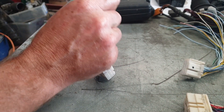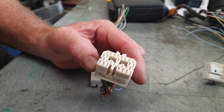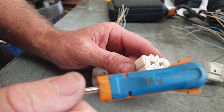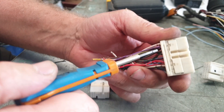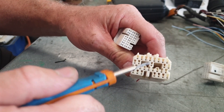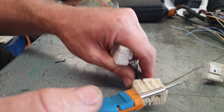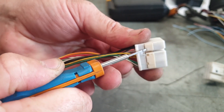Right, we're going to show you how to de-pin one of these plugs. Here's one of the tools I use — this is a TE pick, it's got a single end on it. We're going to lift this lock here. This will work on the 20 series, the 10 series second generation from about '92 onwards. This is a 1UZ VVTi plug and we lift them out like that.